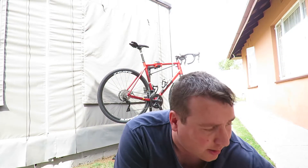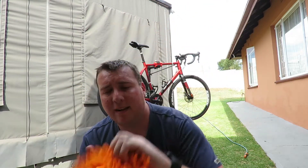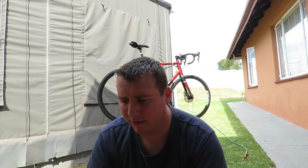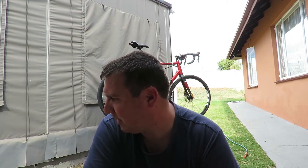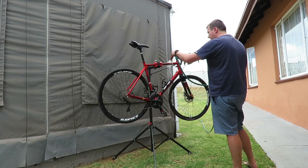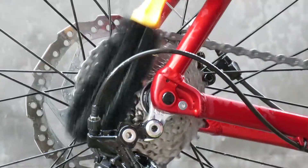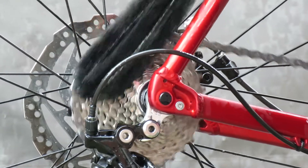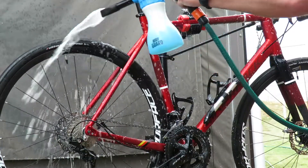I've also got a bucket with some hot soapy water, and the bike cleaning kit came with one of these — it's pretty nice for cleaning the frame and stuff. There's a microfiber cloth, and I've got one of these car cleaning sprayers just to spray soap all over the bike. What I like to do is hose the bike down with the garden hose first, then spray degreaser on the cassette and brush it in with the black brush for a minute or two, then spray the whole bike down with soap from the car sprayer.